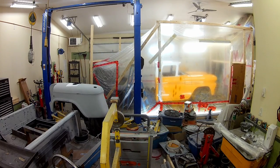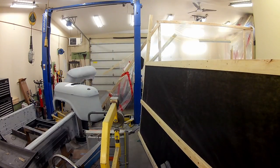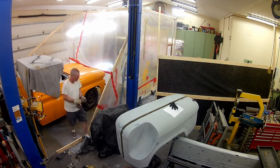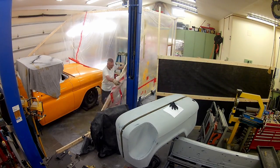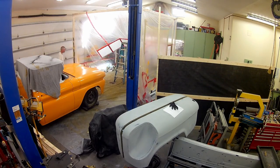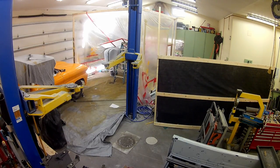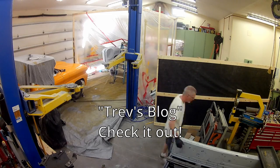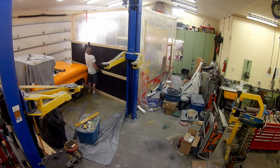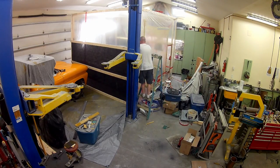Alright, now when I did the spray booth — in my head, because I only have 33 feet across my shop at the front — the plan was I would build a booth, spray the cab, and then push the truck all the way back till it hit the wall and then shorten the spray booth, which I'm in the process of doing. You'll see the black on the end wall of the spray booth — that was a failed attempt at trying to change the airflow using landscaping fabric, which was used by Trev on Trev's blog and it seemed to work for him, but I think I might have chosen the wrong fabric because this stuff really didn't flow all that well. The furnace filters were good, but not on the exit side of things — they plugged up pretty quick.